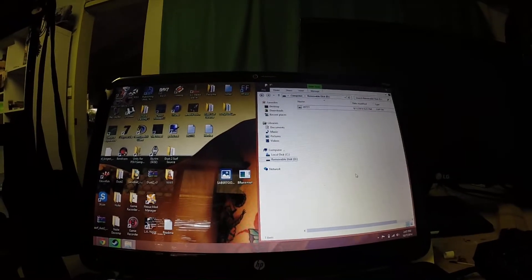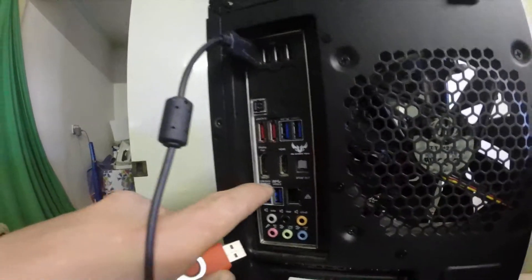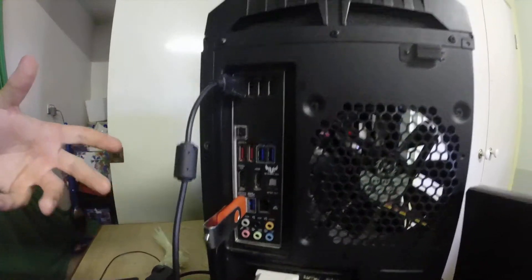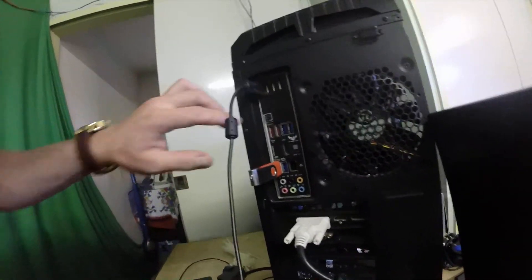Then you want to delete the BIOS renamer from the USB and take it out. So on the Z87, you'll find the BIOS flashback button and you can follow the white line all the way down to the USB port that says USB BIOS Flashback. Put your USB in there and hold the BIOS button until it starts flashing blue. You should try and get a USB that either flashes or has a light on it so that you know it is actually working.